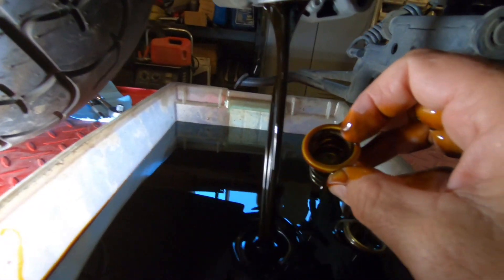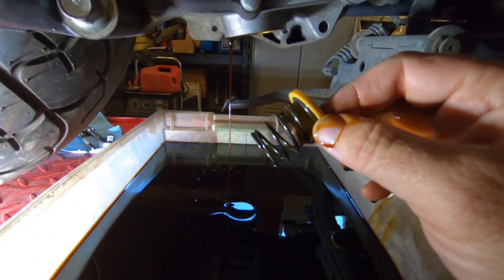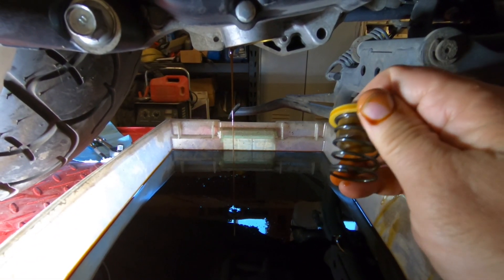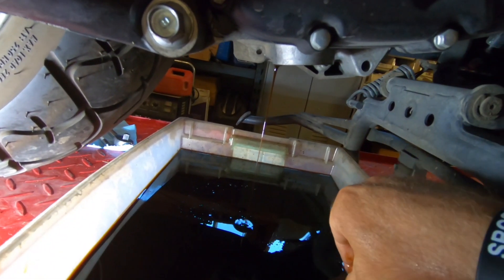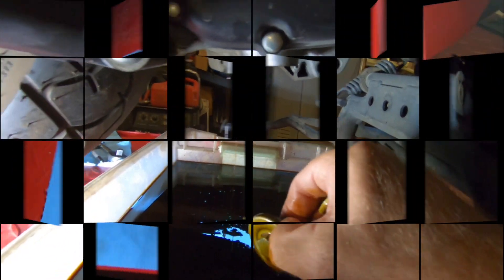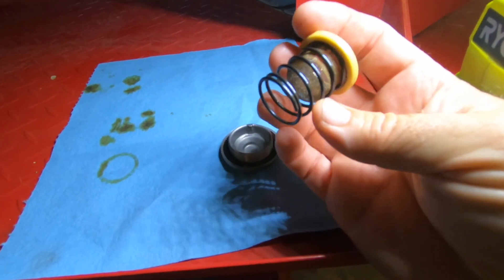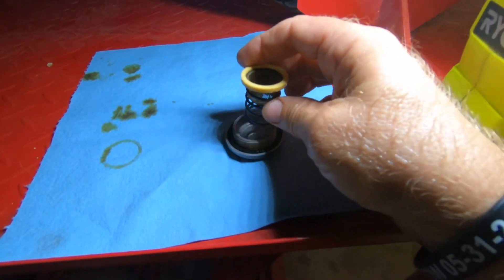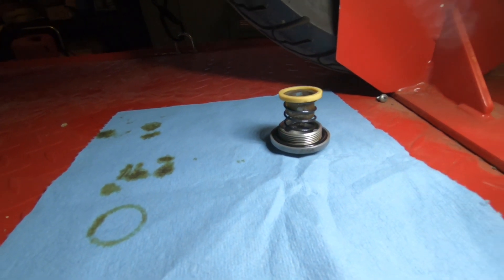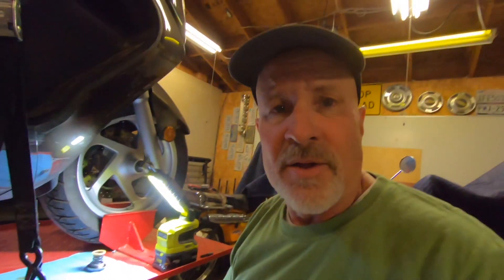Pay attention — there's a screen here you want to inspect, and that's going to drop out with everything. You're going to want to take it out, clean it up, and it'll go right back in where it came from. Try not to lose your cap in the oil like I did — it'll pop down on you pretty quick. Now this is cleaned up; inspect the o-ring. My o-ring looks good — no nicks or gouges. The screen was clean with no debris, so we're going to set this aside and let the oil drain more, then move to the left side to work on the oil filter.